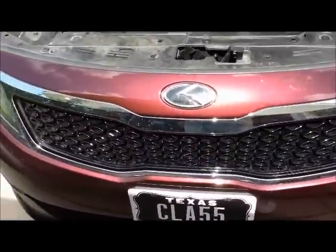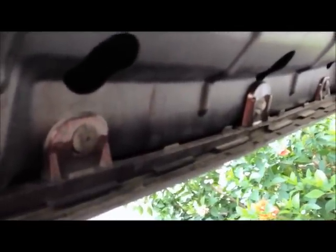We're going to go underneath the car now. Okay, I am on the front driver's side of the car. This is the fog light housing. I'm going under here just to show you some idea of what you're looking at right now. And we're going to have to remove this little guy here. We're going to have to take this guy out. We're going to have to take this guy out. And along the front here, you're going to have several more of these. You're going to have one here. And as you see, they go all the way down. There also is this bolt right here that has to come out. This connects the front bumper to the undercarriage of the car by bolt. Anyway, moving on. I'm going to take this stuff out and I'll show you what we got.